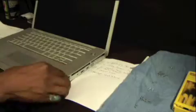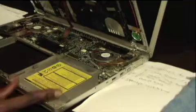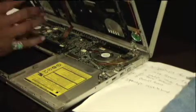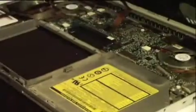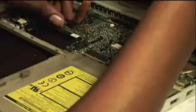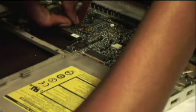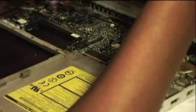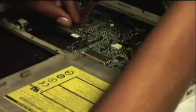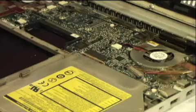Once you've gotten that loosened all the way up, just lift it up to the top and you'll see that ribbon. Now we can talk about that little ribbon — we're gonna gently pull it off, but don't worry because it's easy to put back. Look really closely at that little black plastic block it came off of and the underside of the ribbon cable. Notice how they're notched together to fit a certain way. Make sure that when you reassemble, you fit it right back on its little keyed block. It's not hard — it's just something you need to pay attention to.